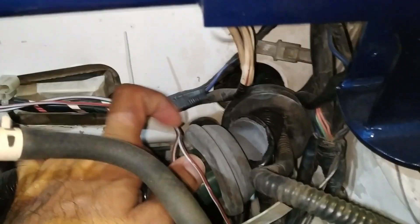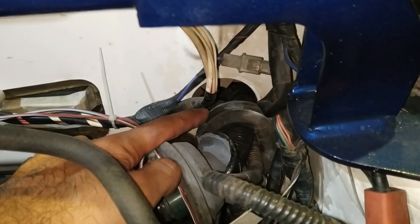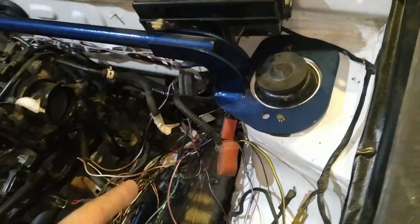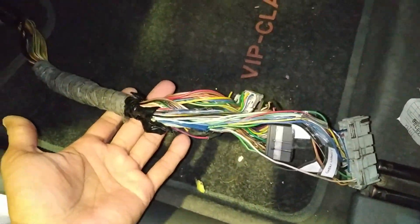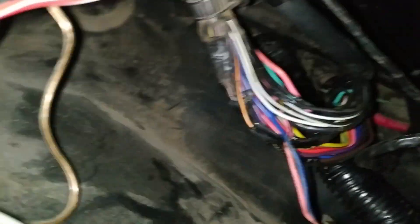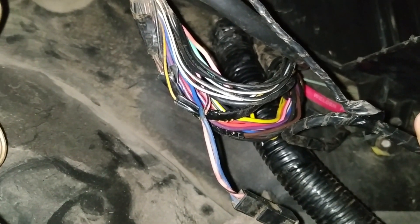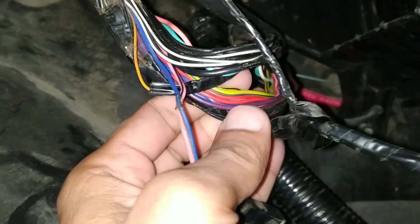The engine wiring route is the same as the original body wiring. I will take off the original grommet and use this one, and in that place this wiring will be going. This wire is inserted here, it will come all the way inside, and this is how it comes out. It is a very long wire - I won't be cutting these wires off, I'll just store them away in the dashboard. The wires are coming from here, I will tap the wires here and connect the ones I need to the engine wiring. It is actually very easy to access these wires from here.